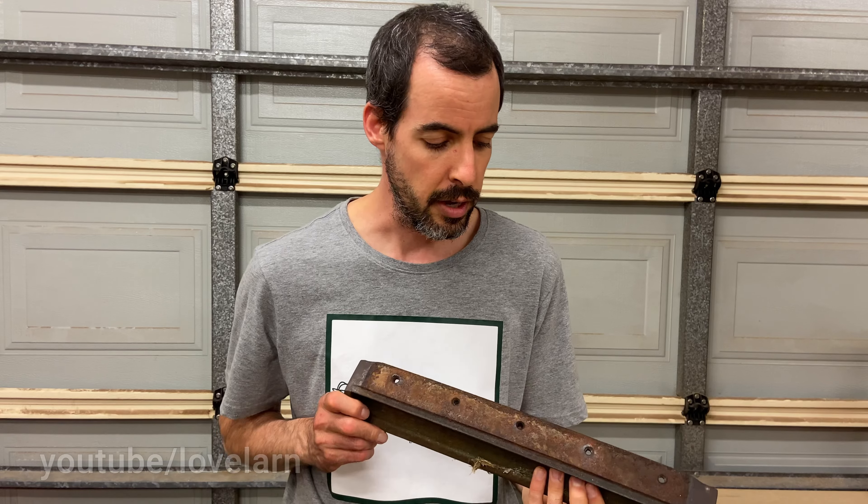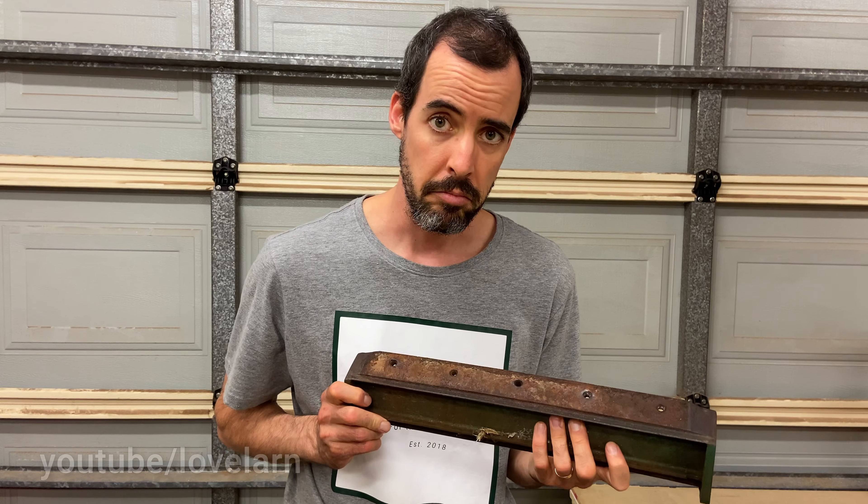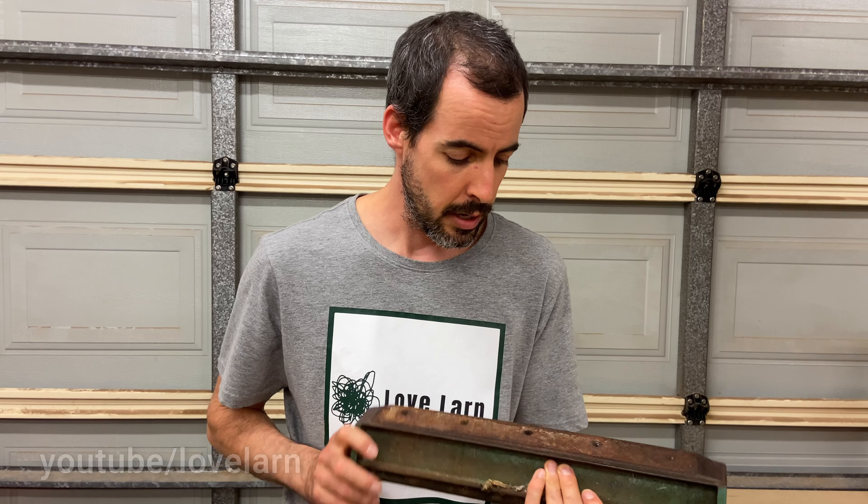So I think that's probably the one main takeaway for today: make sure you sharpen your bed knife on the sole plate. Now, of course, that then begs the question — what do we want to do to prep this thing, and potentially the bottom blade as well?